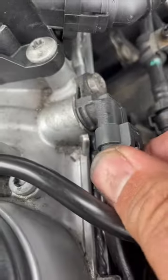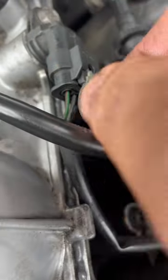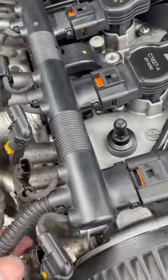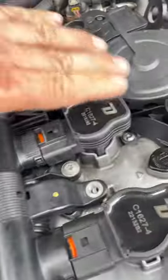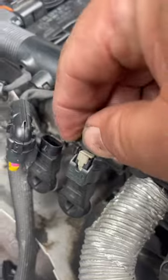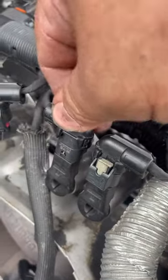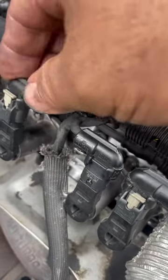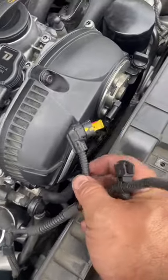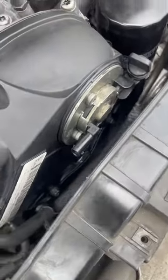Three bolts in. Putting all the clips back on here. To take them off, you push back, that way they lift up, and then you can slide this in. To lock it, you just push it back down and it's on there. Alright, almost done — putting these back now. Install the spark plugs and coil packs. Now connecting all these — this should be fairly simple, just slides in there. Got to put one bolt right there holding the harness down. These clips slide in here and then push down — locks them in. Some of these were broken, so no biggie; they still hold in there. These route back this way — this one goes here, this one goes next to this connector. It's just going to click in there.